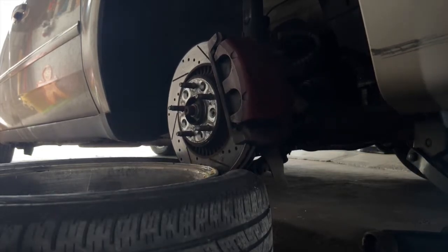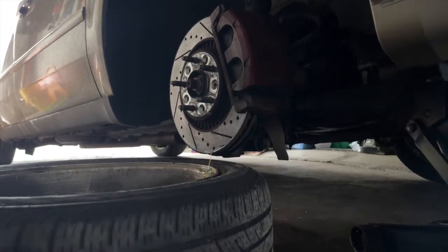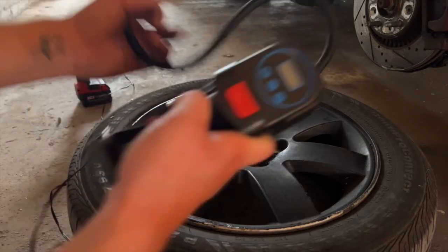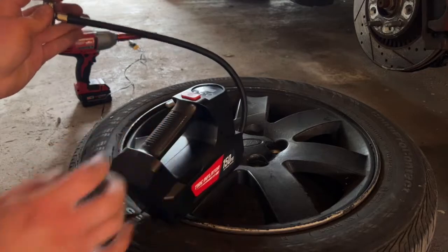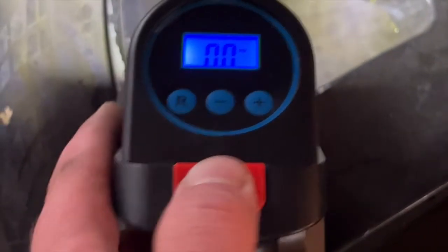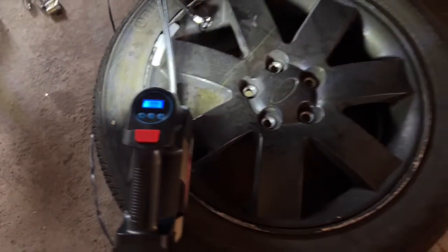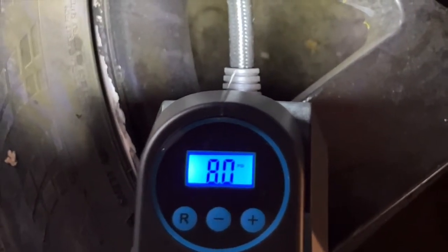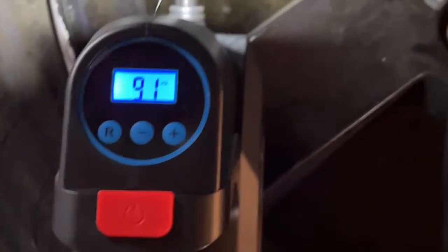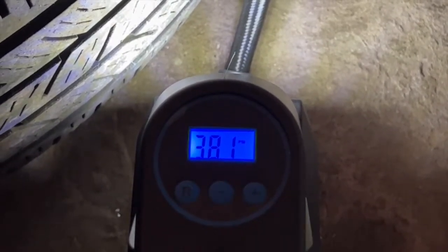Jack up the car so that the bead seats again and hopefully it seals. Just try not to get it on your rotor because that might affect braking in the future. I flipped over the ramp now — I'm about to hook this up. It's a Carson tire inflator; I'd suggest you get one. They work really good, they're pretty fast. Set it to whatever pressure you want for your tire and once it reaches that pressure it'll automatically shut off, and there's also a bright LED light. And just like that, it automatically shuts off.